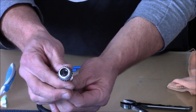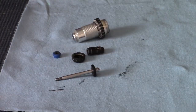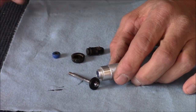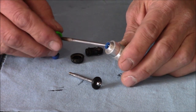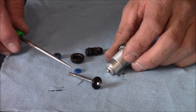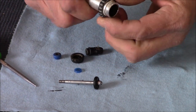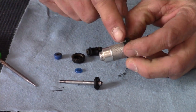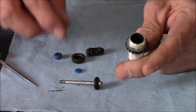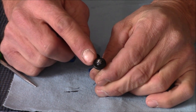Pull that plastic cap off. Now we're going to push our rod from the bottom up through the top to expose our piston and rod assembly. Once you've pushed the rod up through the top and exposed the piston, there's only one more thing inside the body that needs to come out - very gently, with a pick, grab this little blue seal right here. Don't lose it; there is one in the rebuild kit in case you do. That's the last part out of the housing. You don't need to remove the adjuster nut unless you're trying to clean underneath it or anodize the body.